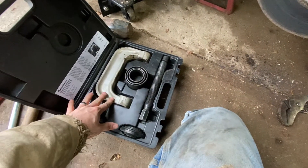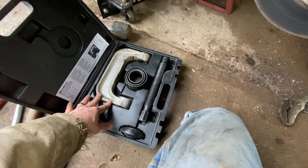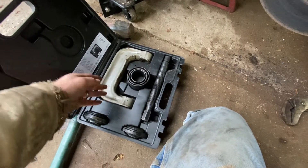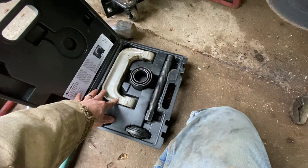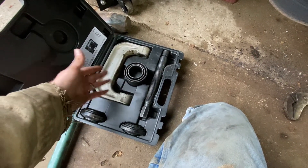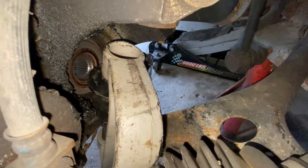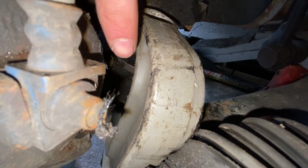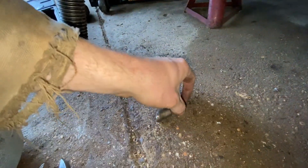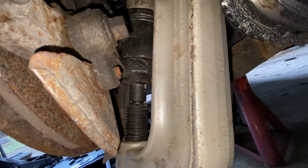At this point, you need to get yourself a ball joint press to press that ball joint out. You can get these at most auto parts stores. I'll have a link in the description below where you can get a press, ball joint, and some other stuff if you want to check those out. You can also rent these at local auto parts stores — basically, you pay the price of the tool and when you bring it back, you get your money back. So, you got one of those receiving tubes right down there and then one of the adapters up here. I ended up cutting off the lower part of the ball joint with my angle grinder, and then you got it set and pushing on it like that. It should push out pretty easy at that point.